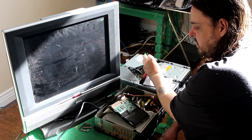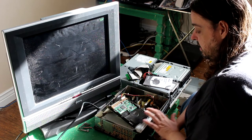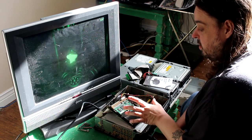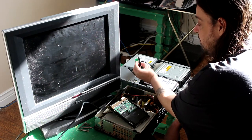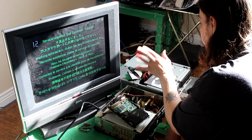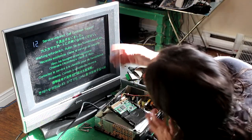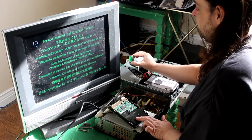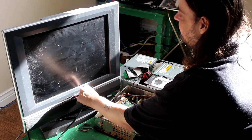From the way Trevor worded that, based on what I know of computers, essentially the reason we're moving it while this is on is because turning this on like so, even though it'll give us an error, is going to essentially make this Xbox drive readable to the computer. Yes. And by plugging it in a moment ago too soon, before our CD was booted, I basically messed that up, relocked the drive, and so that time we won't even count because, again, that was my mistake. Make sure you don't put this into the Xbox hard drive until after you have the right menu on the screen.